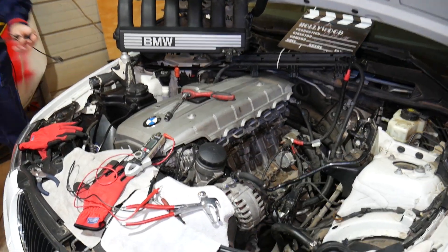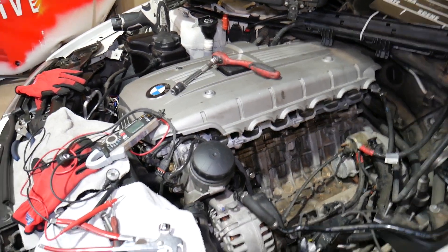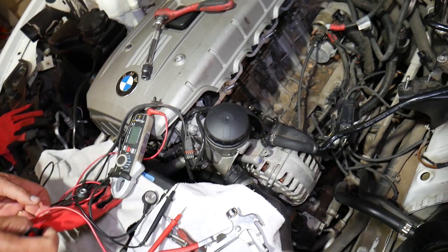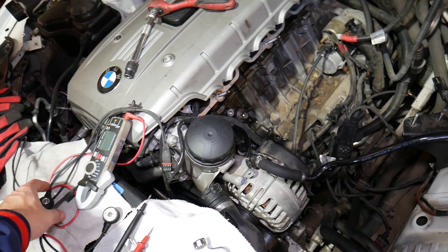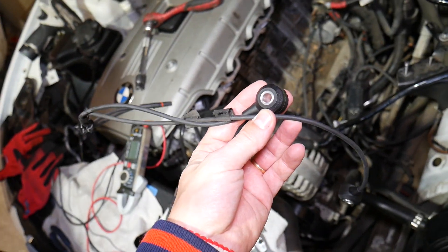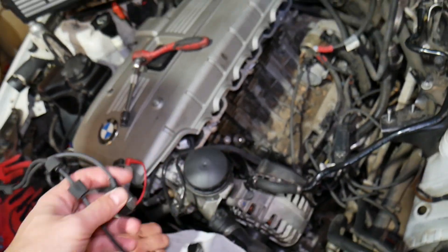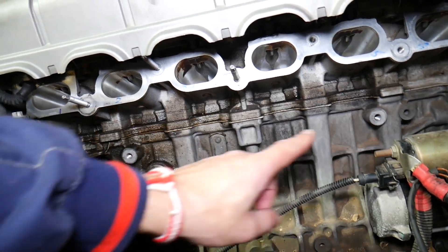What we have here is a six-cylinder gasoline engine, but again it doesn't matter which engine you have. If you need to buy any of the tools, new knock sensors, or parts, we have links shared in the description below for your convenience. On BMWs, most of them will have two knock sensors — four and six-cylinder engines most commonly have two. Certain models may have one, but most will have two. Those sensors are mounted to the upper engine block, like here and here.